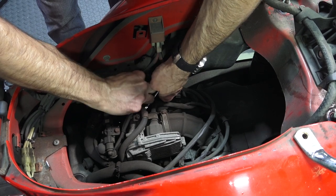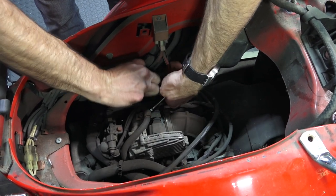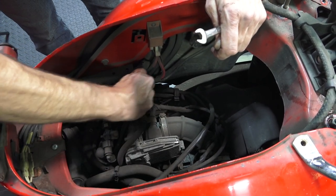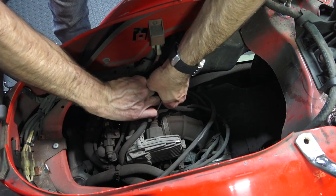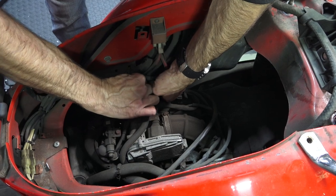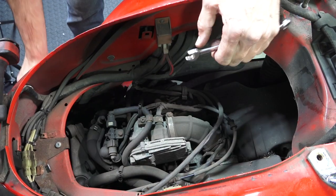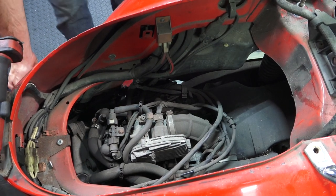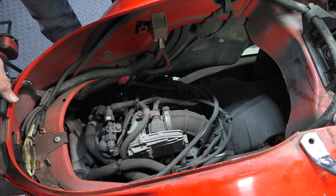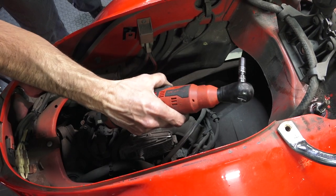If you have an MP3 500 or BV 350, on the BV 350 you can take some bodywork off and get access to the fuel pump without dropping the tank. On the MP3, forget it — pull all the bodywork and you'll have to drop the fuel tank from the bottom. It's a time-consuming job, and I'm not going to make a video on that since not that many people have those needing fuel pumps.